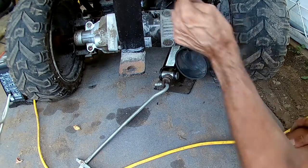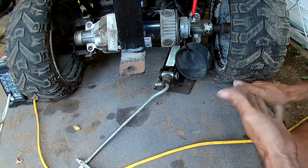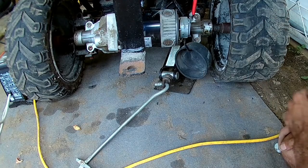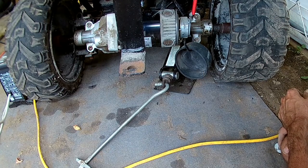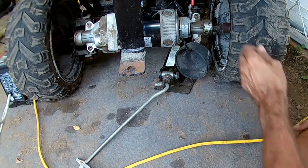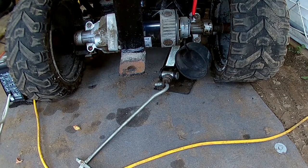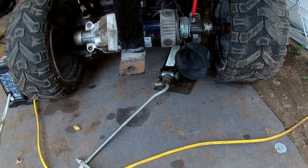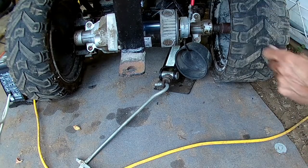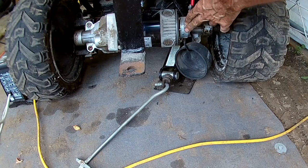Of course I overheated the motor trying to get this stinking thing home with the brakes stuck on. Kind of melted the waterproofing, it looks like. I don't know. But that should be giving me an error. Okay, so with it in manual mode, it gives me error code 9 like it should. So now it's in drive mode. The brake should be engaged.